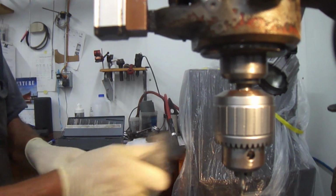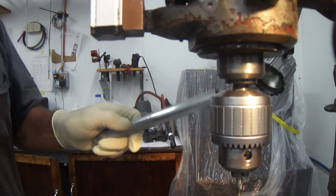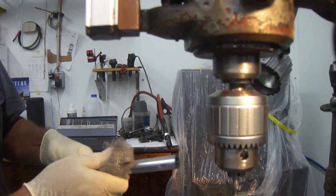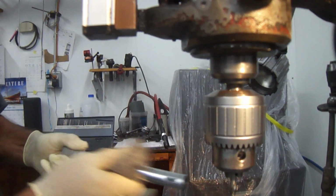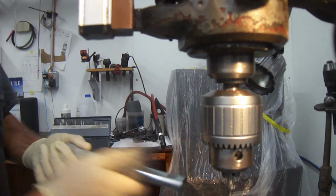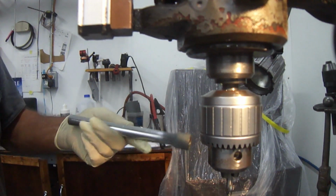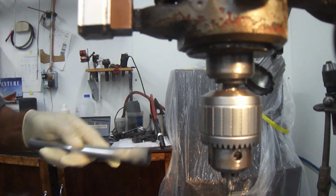It's taking it right down to the zinc. That's the zinc coating. I know you can't tell the difference a while ago, but when I yellow chromate, you can't yellow chromate just steel unless it's got zinc on it. So I'll show you a minute the zinc. But I'm gonna go down and do one more coat of this zinc. See that thing, like it's chrome, it's so shiny.